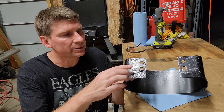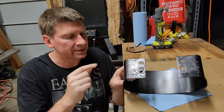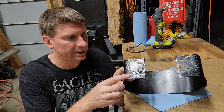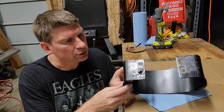I have some rusty pockmarks on this bumperette from my 81 CJ7 Jeep, and I did a quick test. I was actually surprised by how well the JB Weld did in comparison to some zinc primer powder coat that I put on here. I'll walk through that and show you the results.